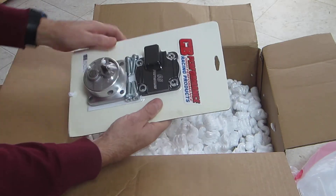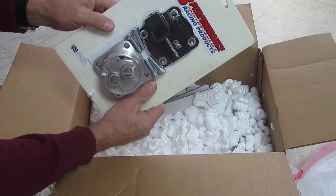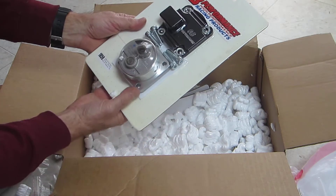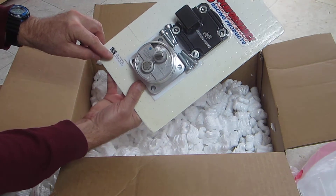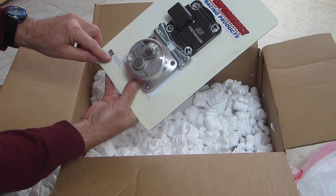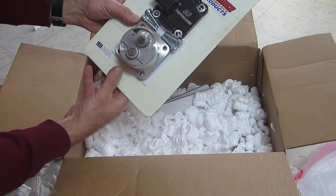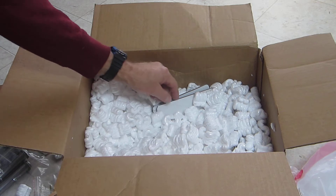Here's a big one — this is a 30 millimeter oil pump that has a cover tapped for a full flow setup. That is what I intend to use with my 2332. Part number 1859 is actually on the list of components on the CB Performance website in their engine builders choice kits, so I'm going with what they recommend. I also snagged this oil filter.